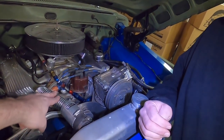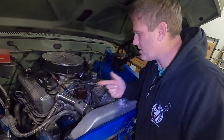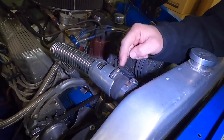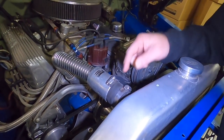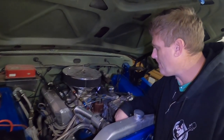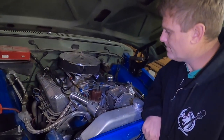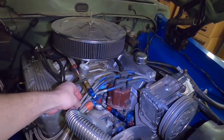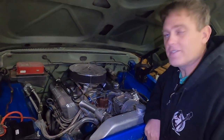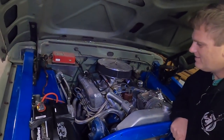The flex hoses are pretty good, but the rubber connector going to the radiator is pretty worn — the rubber's starting to delaminate, so that would want to be replaced before it causes a failure. I'd rather not go with the aluminum housing again. Also, these braided spark plug wires concern me — if a wire is chafed, it's going to conduct in ways you don't want.